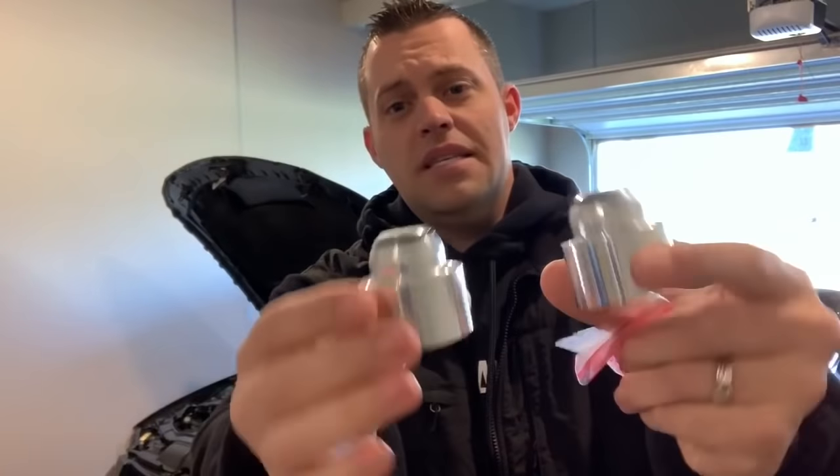It is a long time coming for me to go ahead and service mine. The service kit for the diverter valves that I have on my 335i — you're going to get two new pistons, o-rings for everything that you need to replace for both of them, and some grease.